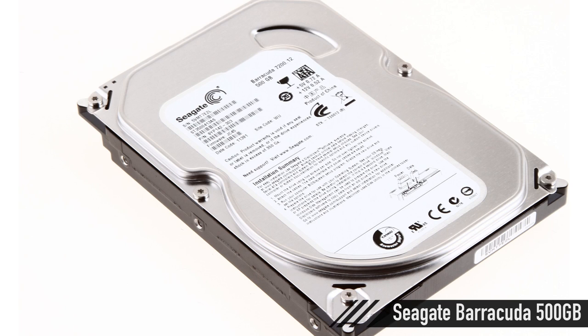For storage, we're going with the Seagate Barracuda — a 500GB, 7200RPM mechanical hard drive. Since it's a gaming rig and a lot of games these days are several gigs, that'll give us storage for games and downloads. If you already have a mechanical drive, there's no reason to buy another one unless it's clicking or making a weird noise. You can grab a 64GB SSD for around the same price for your OS, then put all your games on the secondary drive — just install Steam on the other drive.